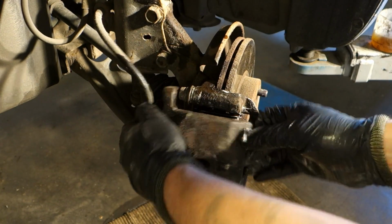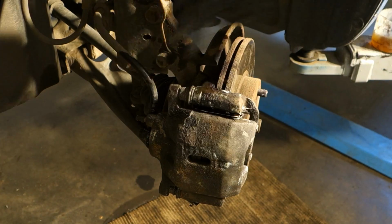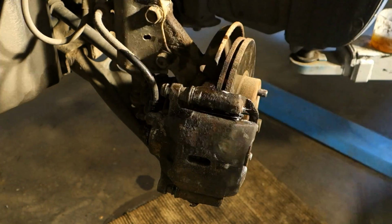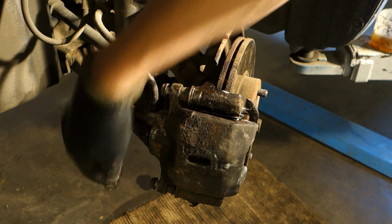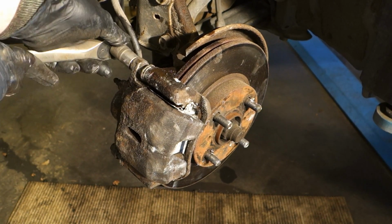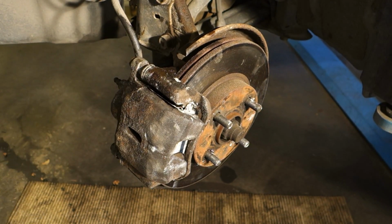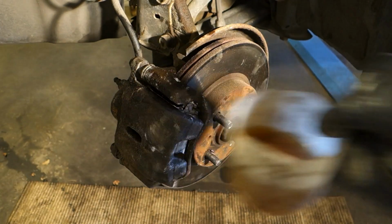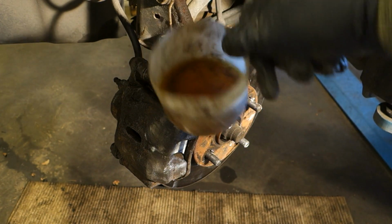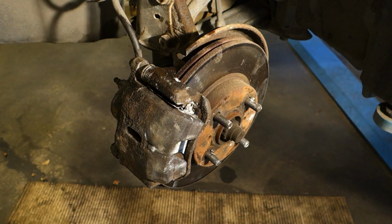And then I insert the brake caliper back and the bolts back. Okay, good. And then I fasten these bolts and then we continue. Okay, and then we need to fasten these bolts. Now when they are fastened, the next step is to add new brake fluid, the same amount, to the brake fluid canister in the engine area. But not the old one, new brake fluid.